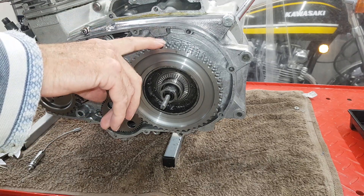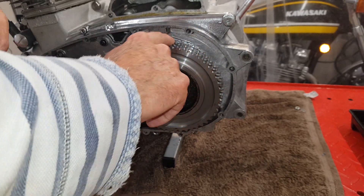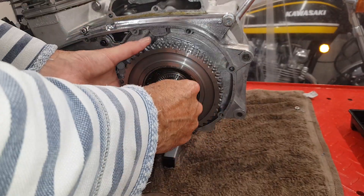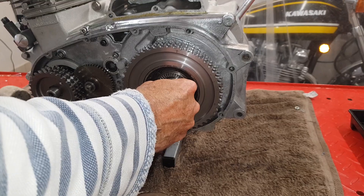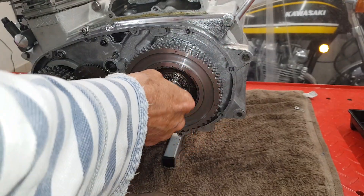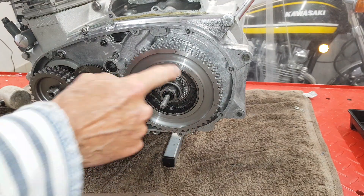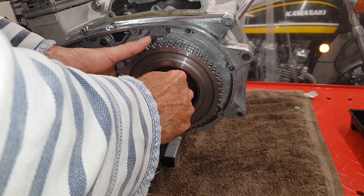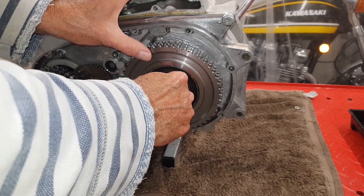...working out where the alignment is. I've temporarily and loosely screwed the chain wheel onto the clutch, and the clutch isn't screwed to the housing — it's loose on those splines — so this is the amount of play you've got. The chain wheel then sits in the outer primary chain case, which goes on here, and at some point the outer chain case will push onto this bearing and hold everything firm. The problem is we don't know where on this axis that is going to be.